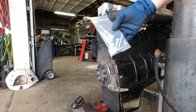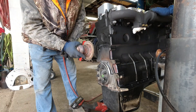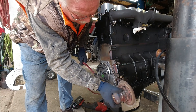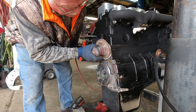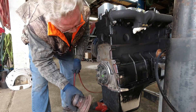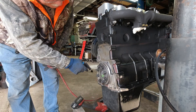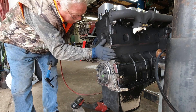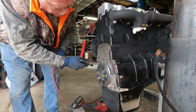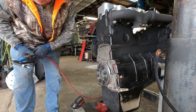Now we need to clean this all up right here. We took a second to clean this plate, the back of the motor, so our bell housing aluminum plate makes good ground — because that's, of course, the starter, the high current deal. And I surely didn't want something as simple as paint stopping us from getting a good ground there.